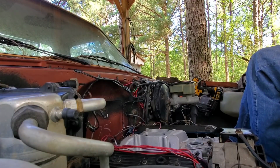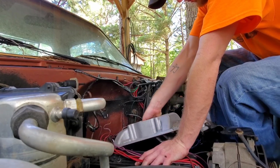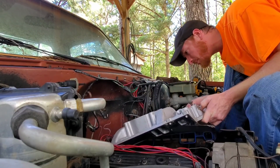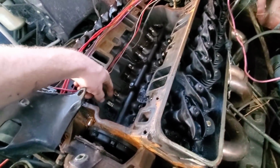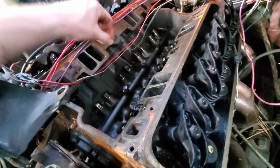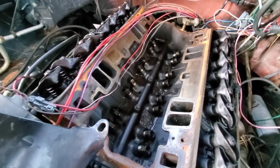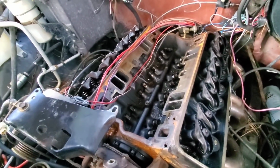Gear broke loose. Trying to save my dang gaskets. There we go. Oh, we got most of this took apart. Lifters, I just got them pulled up. Over time, they get a little ridge built up in there, and it makes them hard to come in and out. So they're all basically just pulled up off the cam enough for it to come out. They'll probably stay right there, but then again, I might try to wiggle them on out of there and clean them up all real good.